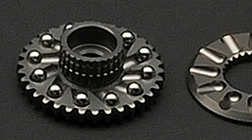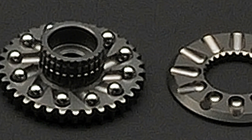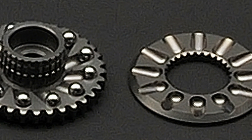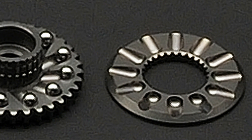If you look at the grooves on these two plates, you can see that they have been cut at different angles and they don't exactly line up. As the ball moves towards the outer edge, the two halves of the phaser will rotate in relation to each other, since the grooves on one half are cut at a certain angle.